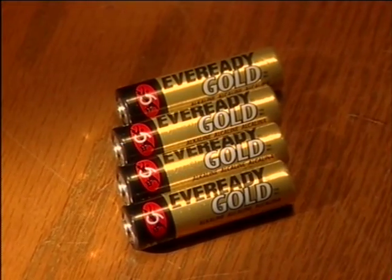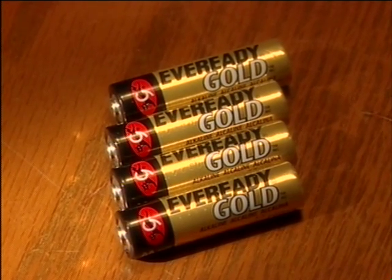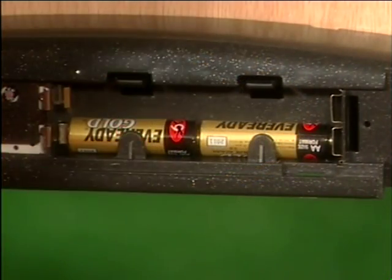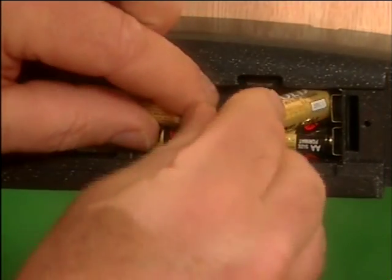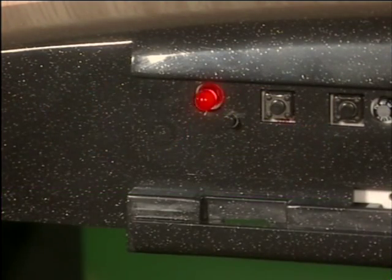Now put the collar key out of sight or range. It's time to install the batteries in your pet door frame. You will need four AA alkaline long-life batteries — these are not supplied. Do not use rechargeable batteries. Install the batteries in position; they are a tight fit — that's intended, so don't worry. After you've powered the dog flap, the unit will emit a low tone beep and the LED will flash. This means that the dog door is ready for programming.